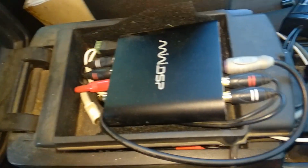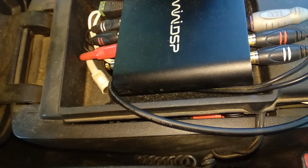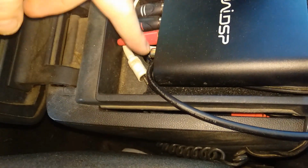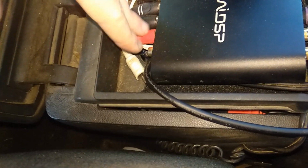But all I've done is I unplugged it because it was kind of connecting and disconnecting. It sounded rumbly. So I just disconnected it completely and boosted this signal by 6 dB. So it was kind of like a bit of redundancy I had. And yeah, this is split, so it's not like each connector does its own amplifier. They're both Y split, so that's all good. And they both have the exact same signal. It was kind of built-in redundancy, so I haven't missed out on anything due to one of them breaking.